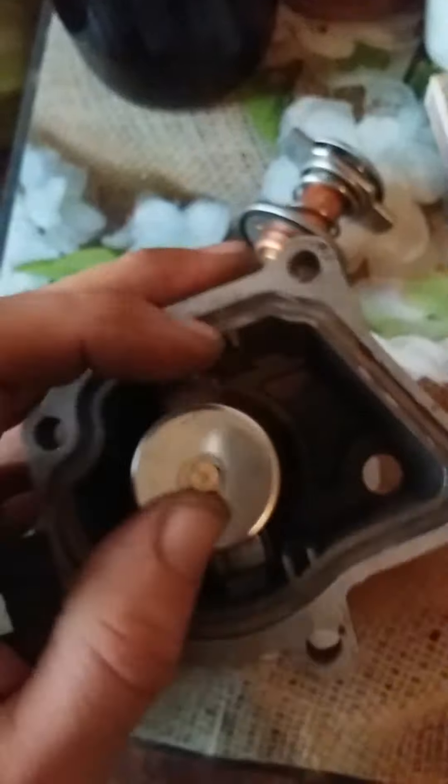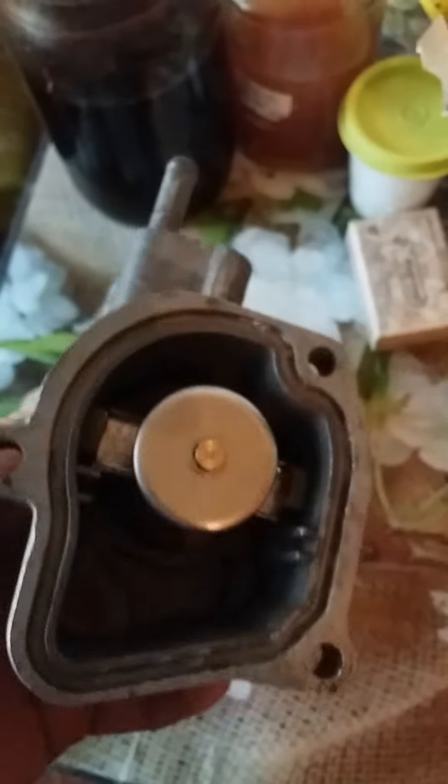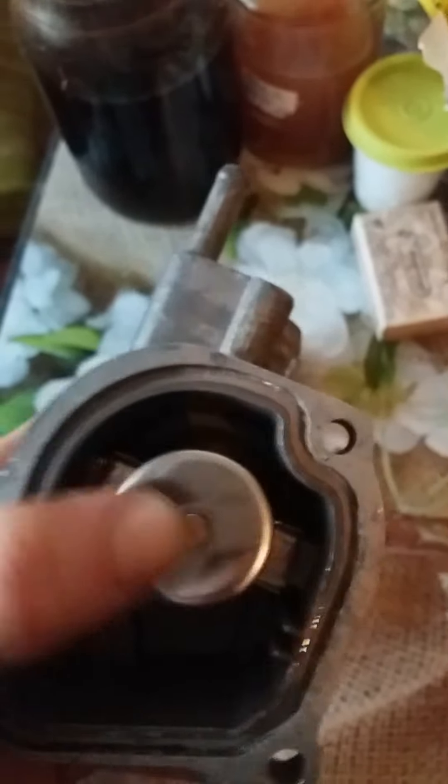But this one — you can see that I can compress that just fine. Please be aware that this thermostat is no good, it is over-sprung. It is over-sprung and it doesn't have a chance to open fully. But this one is easily springable.